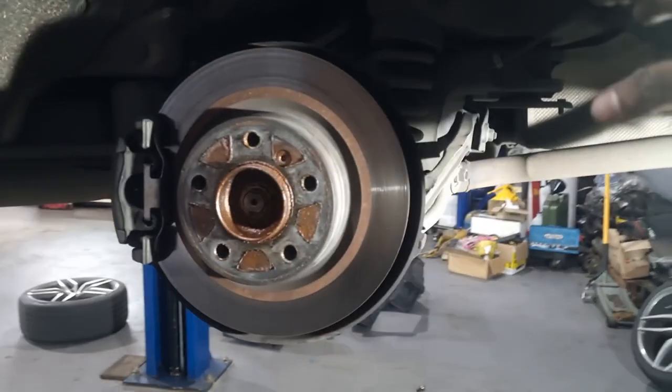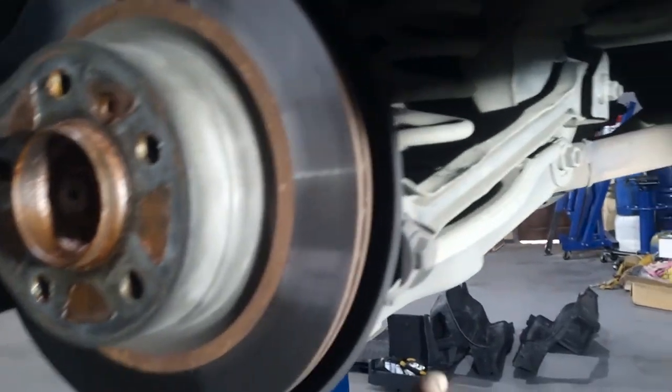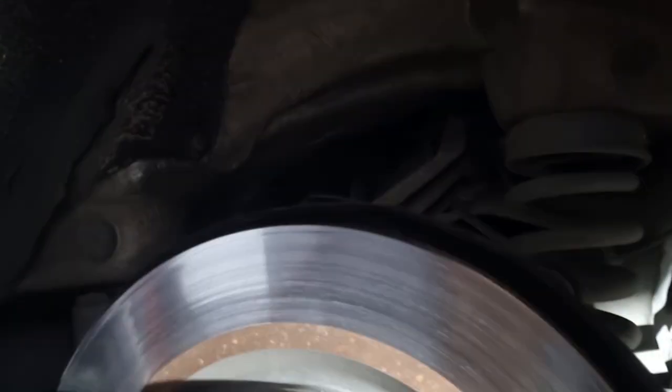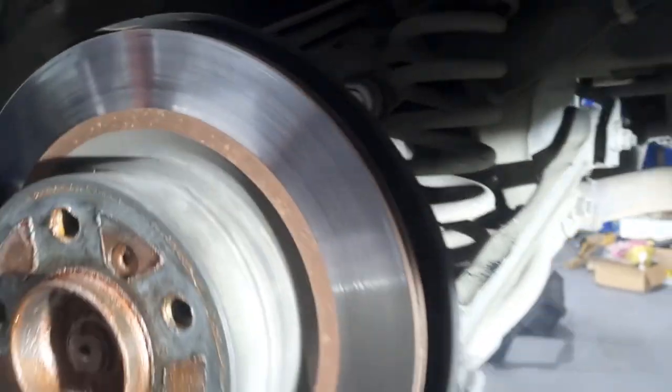To install it back into the car — because I've got the car in the air, it's not going to line up properly. So what I'm going to do is bring the car down, let the axle sit onto the jack stand which I have down there, and pick the wheel axle up so the shock will line up into place and be able to slot in properly. Let's do that now.